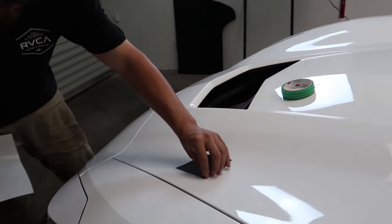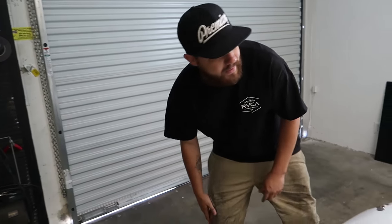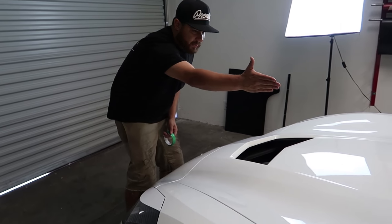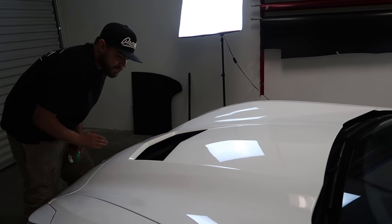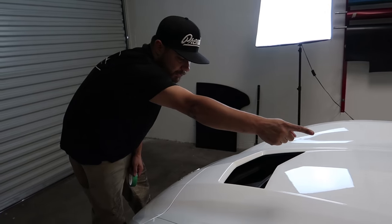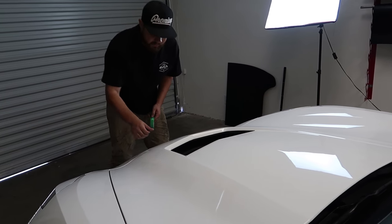It becomes a little more difficult using knifeless tape when you have to create custom lines. It's almost like you're pinstriping. So we're gonna be pulling a line, following a body line all the way through, following it around, and going around this whole area. So I'm gonna use one piece, bring it all the way around and up to that area to create this line.